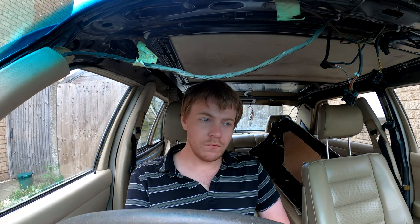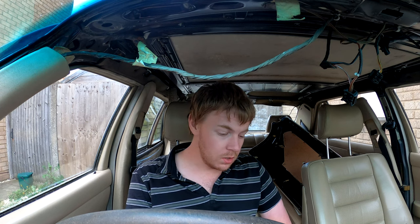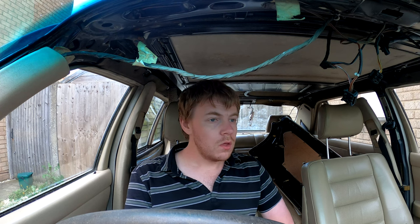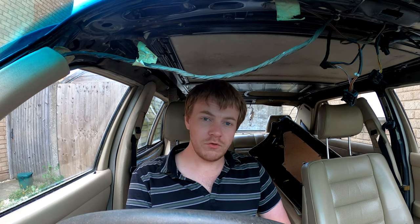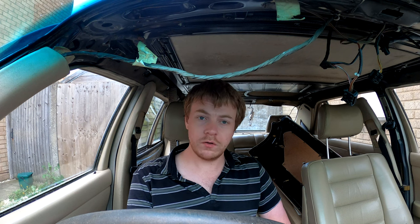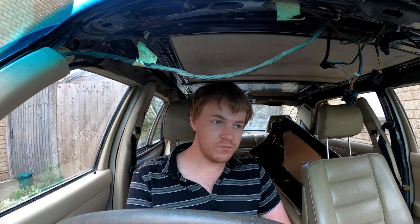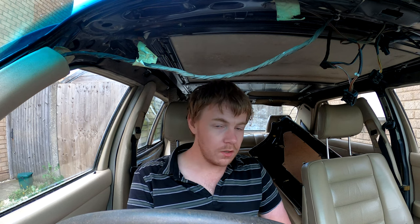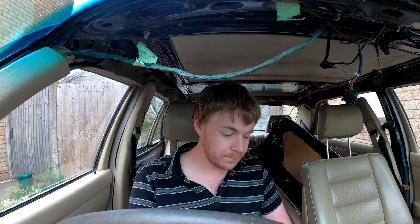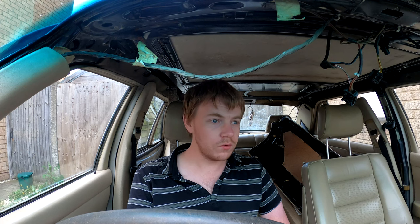How long had that been like that? I am honestly not too sure, because the last time I opened the air filter housing up, prior to the breakdown, was when I replaced the air filter itself. So obviously that hose was rock solid, pretty much more like plastic than rubber. So obviously that was quite hard, and it'd probably been like that for a while. Now I've got a brand new rubber hose on, which is nice and flexible, works how it should, nice and sealed along there now. So hopefully it's not just that one little rubber hose, like £2.20, that was causing that issue.